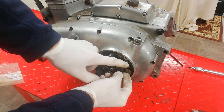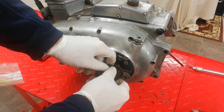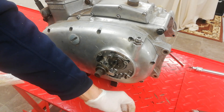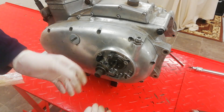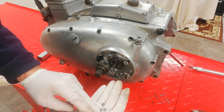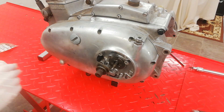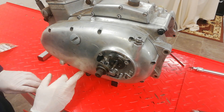Take the clutch cable out of that and it comes away. Then there should be three ball bearings sitting in behind this in these grooves, so when you pull that away the ball bearings will probably fall out — just be ready for them. You can replace them if you lose them, don't worry. So those three ball bearings come out of the mechanism.